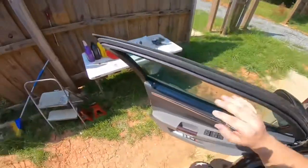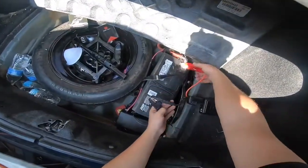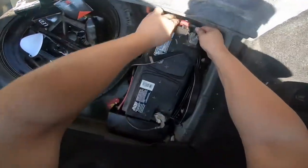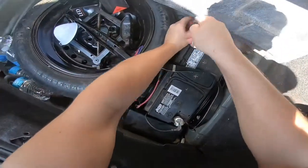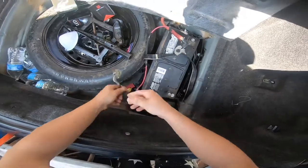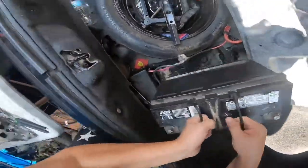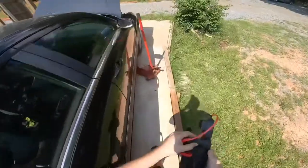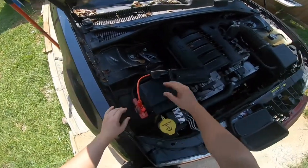I'm going to turn it off. It's a great battery but it's been sitting a while, so I actually need to remove this battery and put it on the charger. But even if there's no battery, I might still be able to pop the hood open. I'm going to pull this device out and pull the battery out — I made these battery cables intentionally easy to pull so I could take the battery out as necessary. The idea is to pull this battery out, close the trunk, hook the jump box up to that little unit, and see if we can pop the trunk.